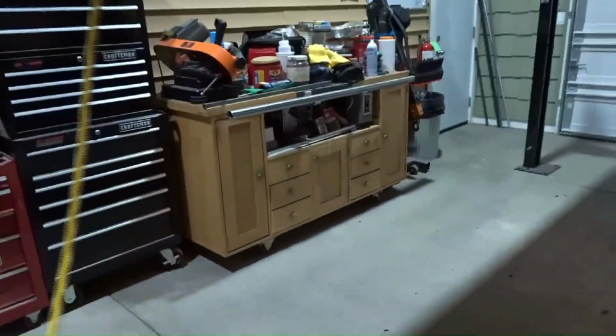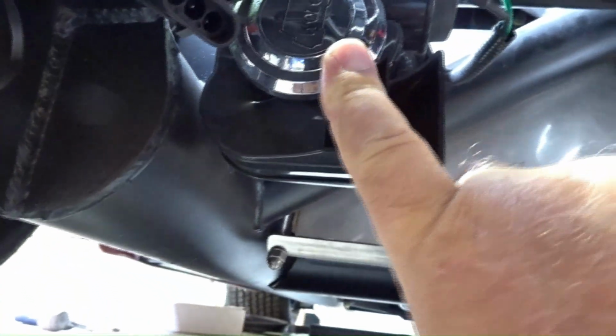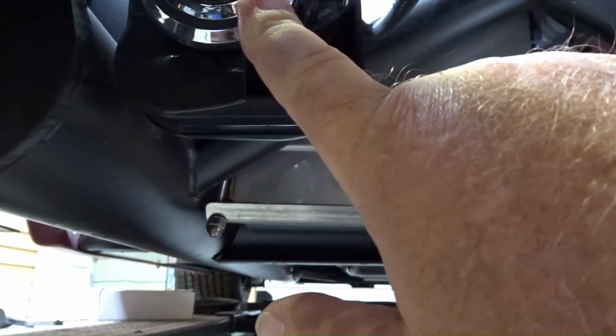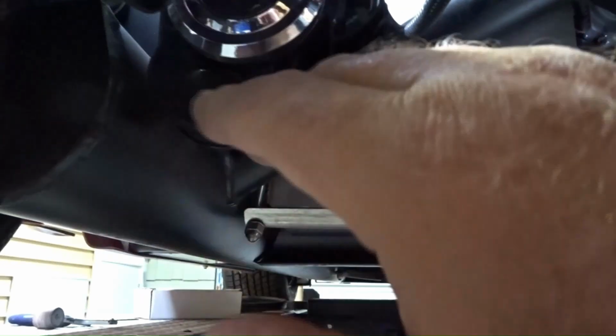The front of the car, I am working on getting wiring strapped and any loose ends that I've been putting off. So for instance, we put the horn over here on the chassis. We've basically got it mounted to the mount for the power steering or the steering rack. And this puts it up out of the way so that hopefully no debris is going to hit it. And then I extended the wires right over to here.